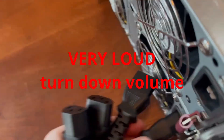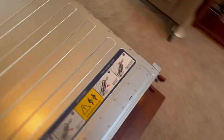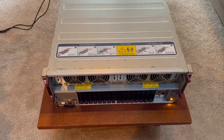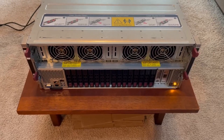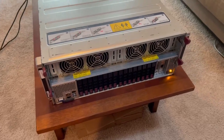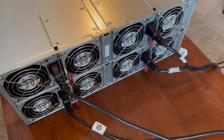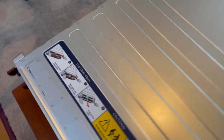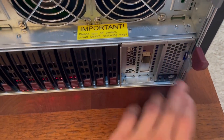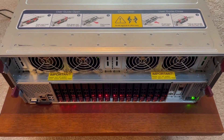So now I'm going to be powering it up — let's hope none of my neighbors are taking a nap, because this is an insane amount of noise. Now it's in a standby state. There are actually two steps to power it up. The first is the ILOM initialization, which spins the fans up to full speed to make sure they're functioning properly, and there are a couple other checks to make sure it's all configured correctly. When you actually want to power it up, you press this button.